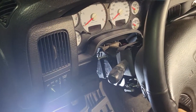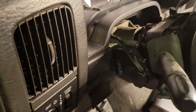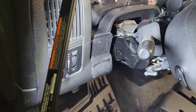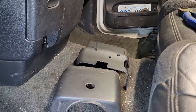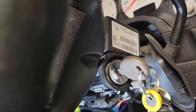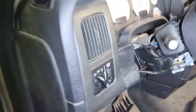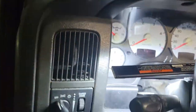I didn't know at the time, but it was intermittent because of the position of the steering wheel. The culprit is this ignition switch — this black switch right here. It's very easy to access. You take off the bottom cover with three Torx T20 bolts, pull this out, take off the bottom, take off the top — bada bing bada boom.